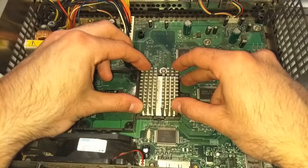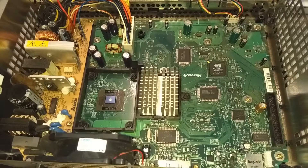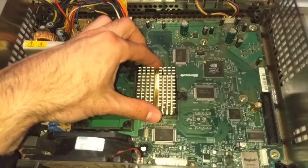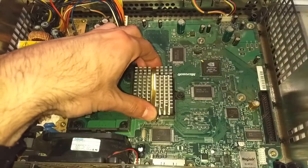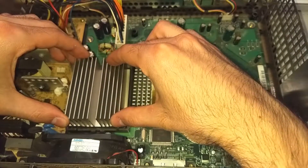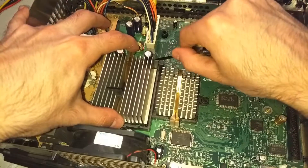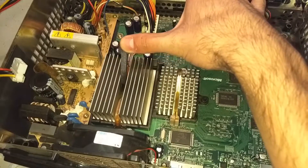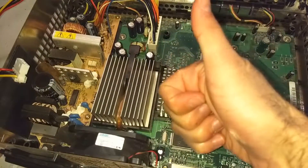When putting the heatsinks back on, I like to place it on and then firmly hold it down for a few seconds to make sure it's spreading evenly right away, which helps prevent air bubbles from forming underneath. Use the tool to help put the clips back on — once you hear the click, you're good. Do the same for the other one: hold the heatsink down for a few seconds tightly, then grab your clip and put it back on exactly the same way as you took it off. The only thing to remember is that once you have the CPU heatsink and clip on, you have to push that black arm all the way down to secure it. And there you go — that's how to replace the thermal paste in the original Xbox. Thanks for watching.